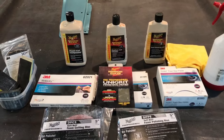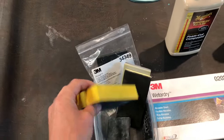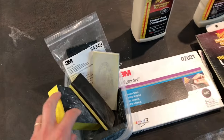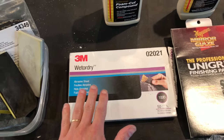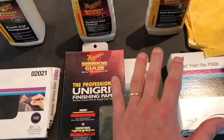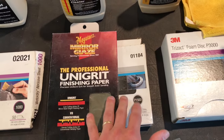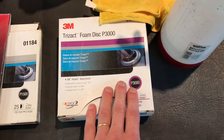These are some of the products I really like to use. You're gonna want a couple of various sanding blocks — this is a 1000 grit sanding block with the paper already attached. Some are just different wet sanding blocks that you put your own paper on. I'm going to be using 1000 grit to start to really flatten the surface out completely, get rid of all imperfections, and then from there I'll only have to sand out the 1000 grit marks. I have 1500 for hand paper and 1500 for the DA, and I'll be using the DA with 1500 everywhere I can.